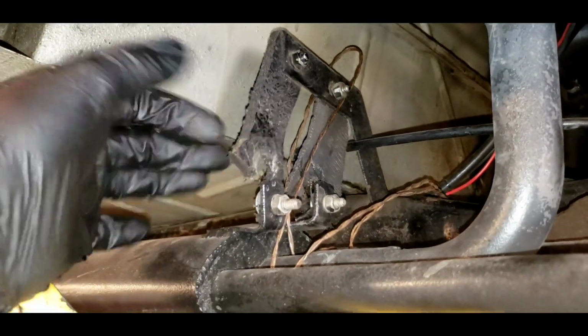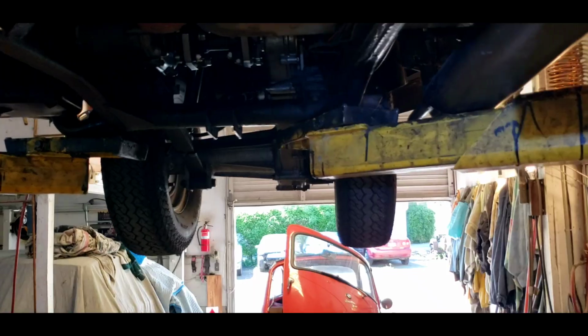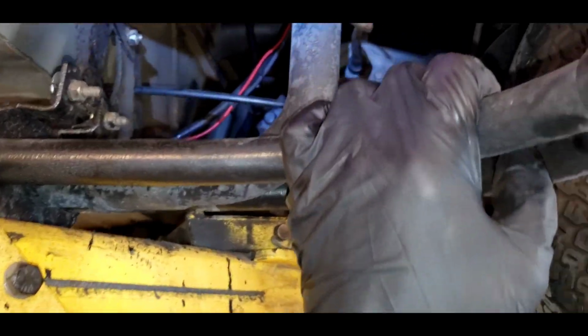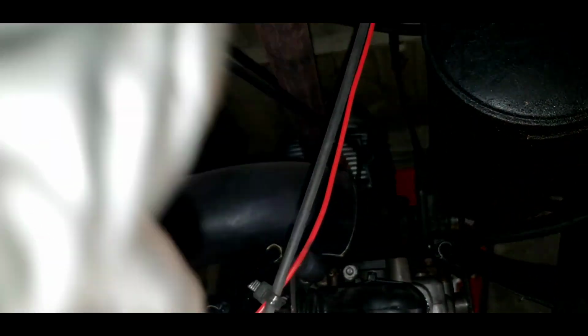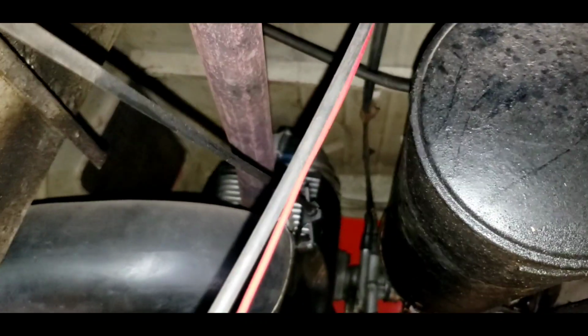It's all wired up, and I don't know if we'll have enough time to take it for a drive, but we're going to try. Okay, my day just got really crazy. Here I am working on this Isetta that came in with a broken muffler and a couple of torn Guibos, and I grab hold of the head pipe, which is the exhaust pipe that comes from the engine. If you can see this, I'm going to grab right here and push. Can you see that? I'm pushing this up and down, the whole cylinder head.